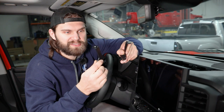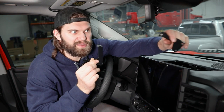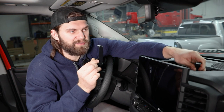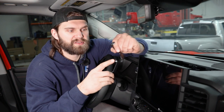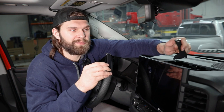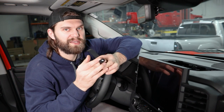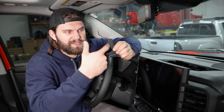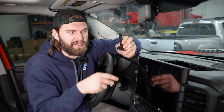These are going to be the two rear mounts — they're essentially mirrored parts. For example, with this one being the passenger side, it goes basically straight down into this back right corner. There are two bolts down in there that need to be removed so you can reuse the factory hardware and bolt through our bottom mounting holes — you'll need a 10-millimeter socket for that. It'll be the same thing on the driver's side using the mirrored bracket. The easy way to tell them apart: they slant up and back toward the rear of the vehicle, and these bottom flanges go in toward the center.